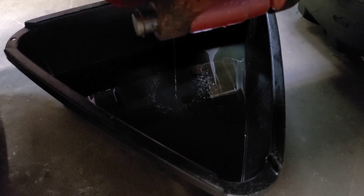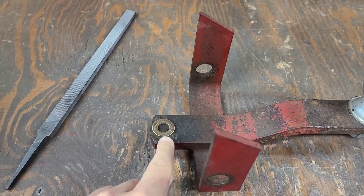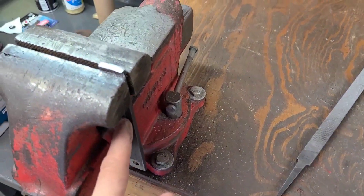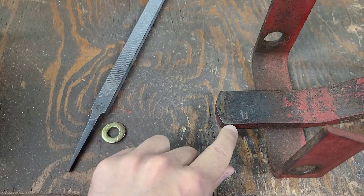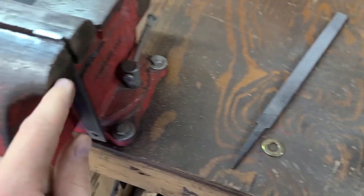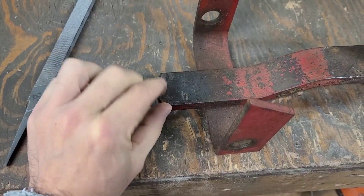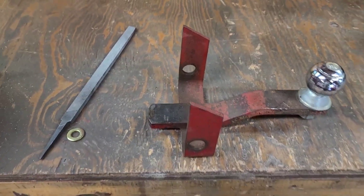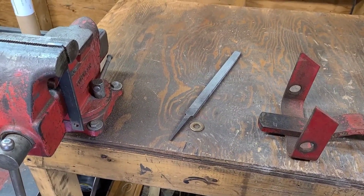With the hitch off, I was going to shim it with a washer. I'm using a thick hardened washer but it wasn't quite enough, so I went into my junk bin underneath my workbench and pulled out this piece of band iron. It's just a hair thicker than the washer. I'm going to measure a piece, cut that off, sand it down, and tack weld it right to the hitch. That's going to give me that little bit of extra thickness to push the hitch ball up so it should be straight. If I need to dial it in with the die grinder, I'll do that. This should be a really quick project.